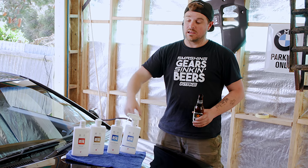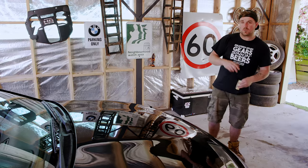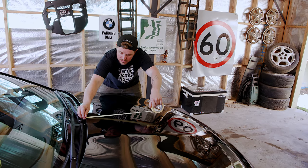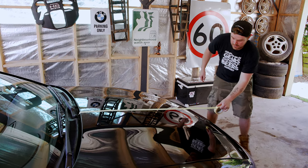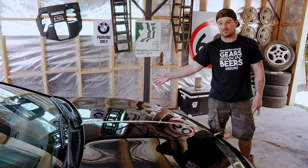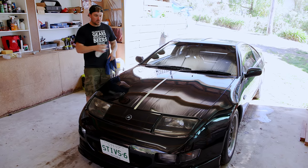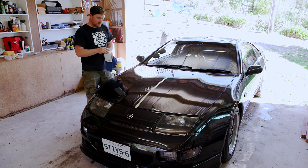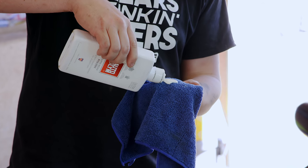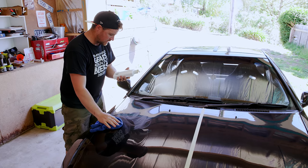So this is just to make the car look nice in the sun, and it's going to look fucking awesome — this deep black metallic paint looks awesome. Today we are going to do what every other bastard does on the internet and tape right down the middle of our bonnet, and do one side so you can see what it looks like before and after. This is going to be fun — I've never done one of these side by sides. Shake well before use, always use clean cloths. A bit of super resin polish onto the polish applicator, apply a thin layer to the paintwork in overlapping circles. Increase pressure over any marks like watermarks. Allow to dry.